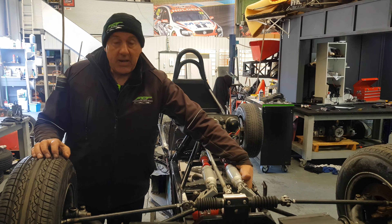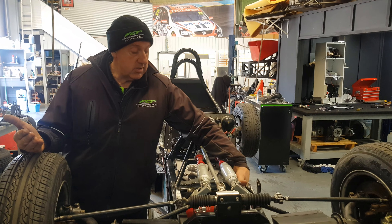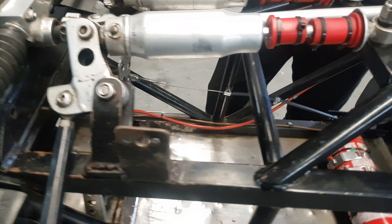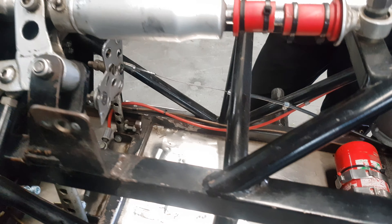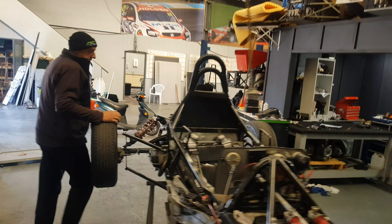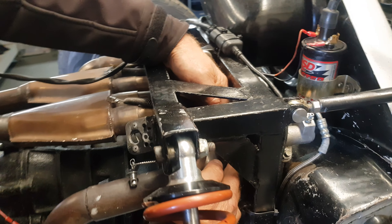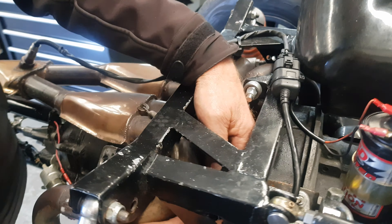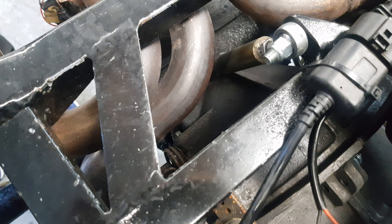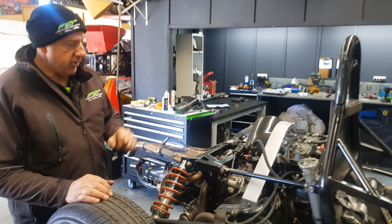Clutch — we don't want too much play in the clutch before your clutch pedal engages, in other words disengages the engine. There's no point pushing the clutch pedal 10mm before anything happens. So we adjust at this end, and also down the far end by the engine, to make sure there's no play. Back here at the slave cylinder — we basically just want just a little bit of movement in there only. That means when we push the clutch in, it's going to work straight away with no delay, and that's nice. But you must have a little bit of movement — don't have it too tight.